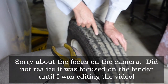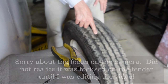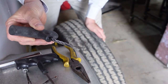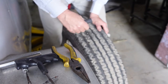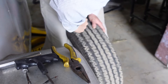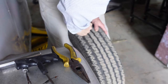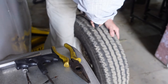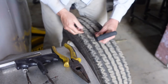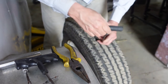Now we've got to clean it out a little bit and then put our plug right in there. This is sort of a reamer — it helps to clean the edges of the hole and also helps you find what angle you're going in at. This hole is at an angle; it's not straight up and down the tire. We're going to have to shove the plug in at an angle.